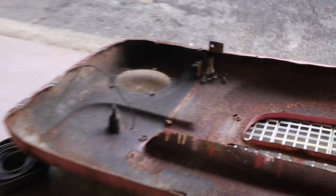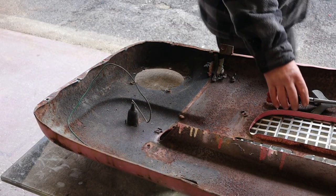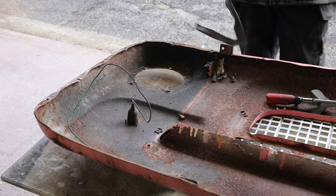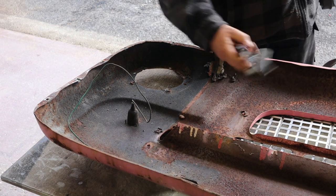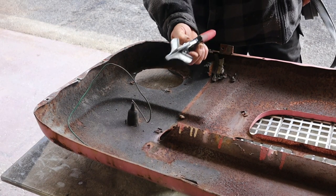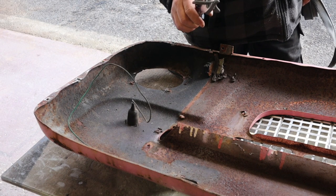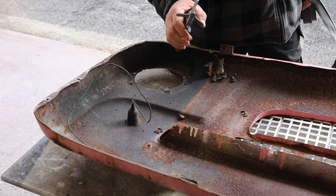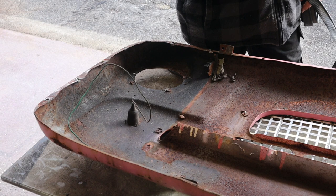Right, that's that. Let's get this here. Where's my cutters? There they are. If you ever do a bit of rubberizing, putting rubbers in, window rubbers, wing pipe in, any of that malarkey, and you do quite a lot of it, invest in a pair of these. Can you see those? It'll give you all the angles: 45, 60, 75, 90, 105 and 120. And you can cut things nice and straight with it as well. You don't have any Stanley knife worries. It does take a Stanley blade.